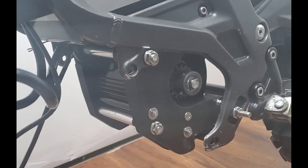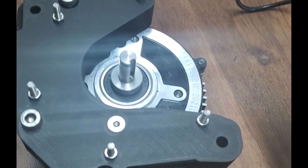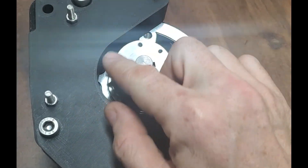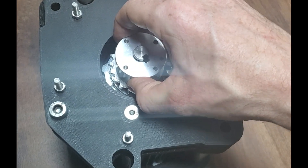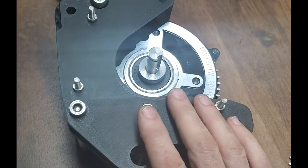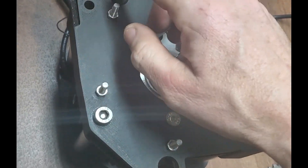Where I think this design is going to live or die is effectively the counter rotation of the motor. If I show you on this one — if we put this sprocket on here — when the motor turns under load, the sprocket is going to be spinning around like this. But if you were to hold this still, the motor would spin the opposite way. The key is: have I got enough reinforcement with the five bolts that go all the way through the motor to the other side, with the additional M8 points?